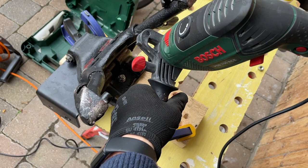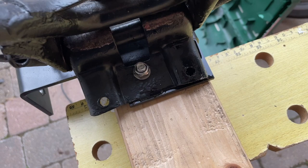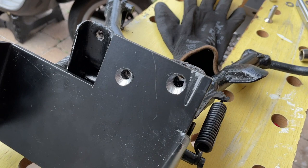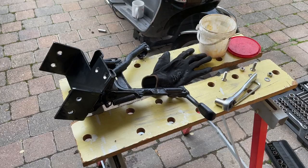I've got the bracket off and I'm about to drill an extra hole, which is basically into a pre-existing hole in the stand. I'm going to drill into my bracket there - it's got to be 8mm diameter and this is steel, so this could take a little while. Okay, I got the hole done, also countersunk it a bit to match the other one, and I'm ready to put both bolts back in. Hopefully that will make it less wobbly when it's on the stand.